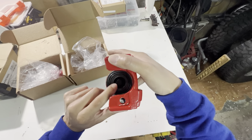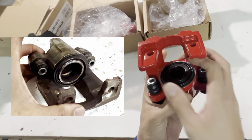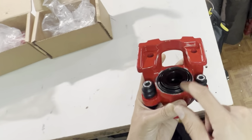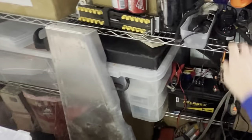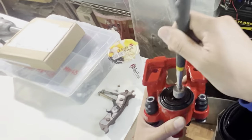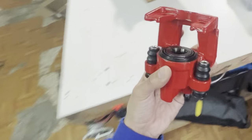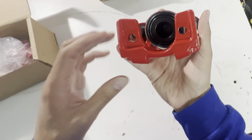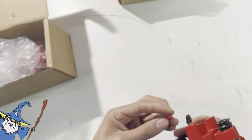The 8.8 calipers have a steel piston and it's a lot larger — that was the whole problem in the first place. But these Power Stop calipers have aluminum pistons, same as factory. They're not magnetic. That was correct information — courtesy of Mr. Blaine of Black Magic fame, and Curry and Savvy and all kinds of other fame. That dude is a wizard.